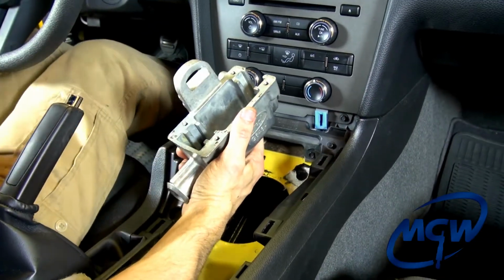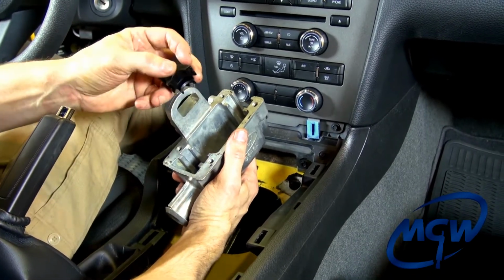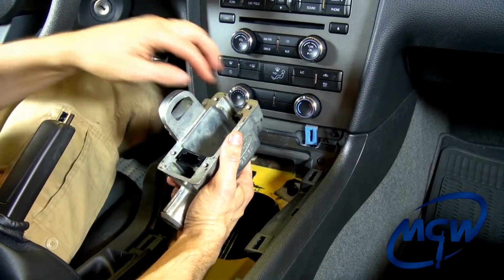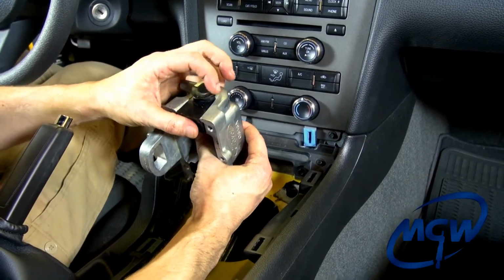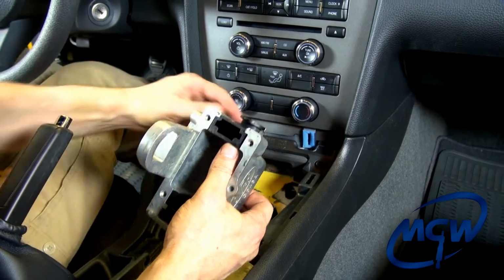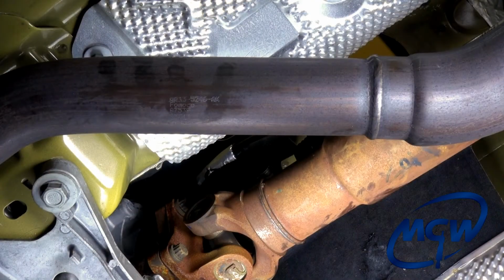And you want to go ahead and just put your factory stuff back together. The one in the rear goes with the little flange facing the back. Stick the OEM bushing in there. And this one goes the opposite way facing the front. You can see when they're put together, that is your flange that the dust boot that's on the linkage rod snaps around.